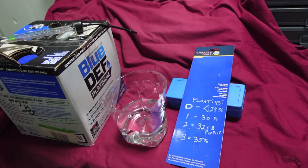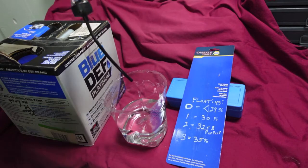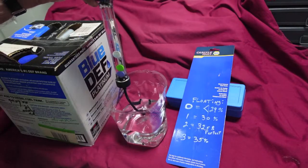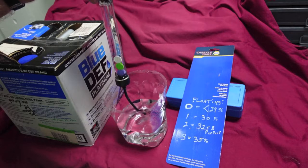To further test the DEF and see where it was, we'll use this floating disc meter and check it in some water right now. This thing is like $20. I had to special order it from Napa — they never had any in stock. This was down in Florida and I think this piece of junk was $20. It showed the DEF to be bad.